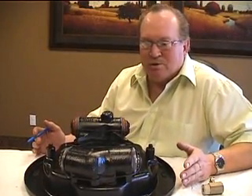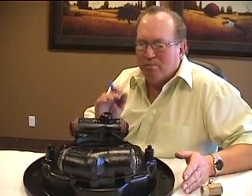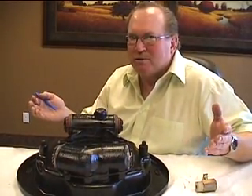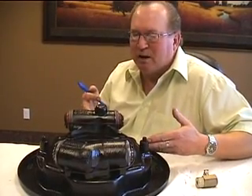So we really encourage: get rid of your old brake fluid. Let's start with a clean slate. Before you push a brake pedal or bleed your system, let's make sure we're putting in clean fluid into these cylinders. Why defeat the purpose? Put a new unit on and inject it with dirty fluid. So let's do that first.